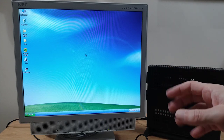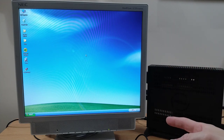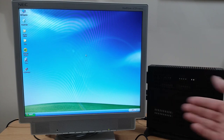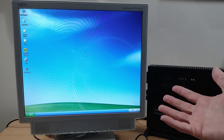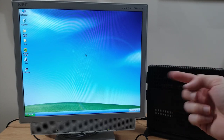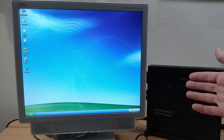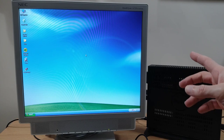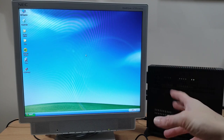And I'd tried different versions of Windows XP, I'd tried different disk controller modes, I'd tried all sorts, and it was only when I was swapping about between all these versions that I just happened to plug the USB stick back in the front USB ports on the machine. And then I finally got back to the original blue screen with the IRQL not less than equal to blah blah blah. Now, the rear USB ports on here that I was using are the USB 3 ports.